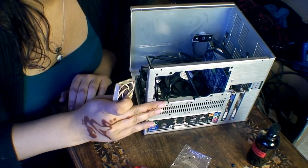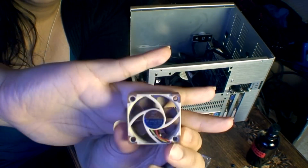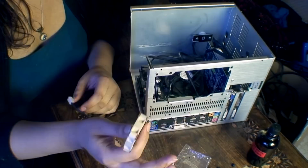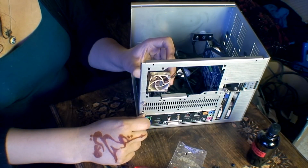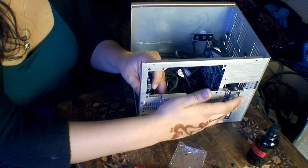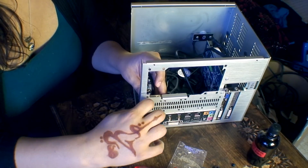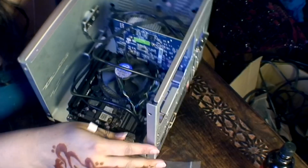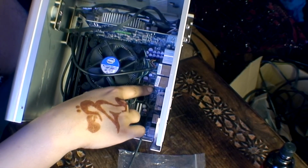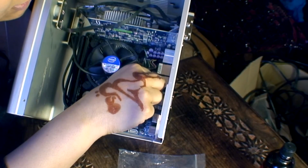So basically, I want to connect an exhaust fan on this case. I got a Noctua fan. If you're good with computers, you'll know that Noctua is one of the best. So you want this Noctua fan in the top slot because, of course, heat rises, and you want the fan to be at the top so it takes out the heat at the top. Just here, if you can see that, is a chassis fan header. So you just need to slot that in there.